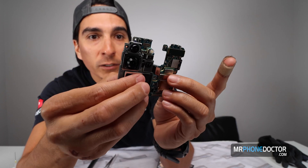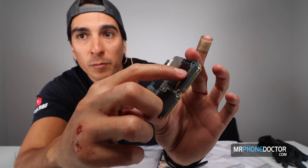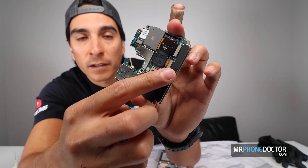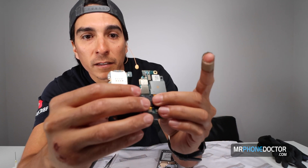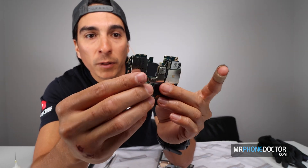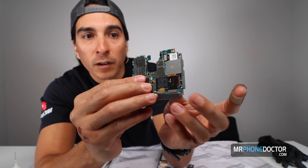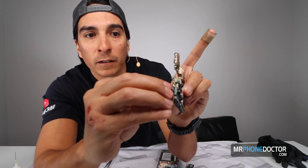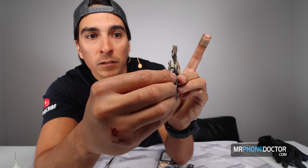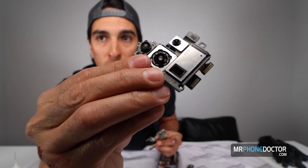The camera is actually really loose — looks like it's just held on by these flexes in the back here. You have some flexes here, here, and then this one here. So you have your main flexes attached to that. These are replaceable — if you did want to replace them, you would simply remove the flexes here, the back ones here, and this last one on the edge. And that's it — it just slides right out. That's the camera.